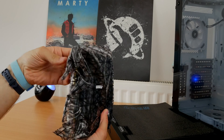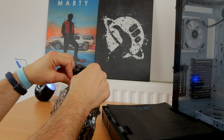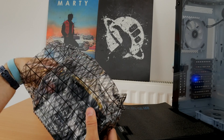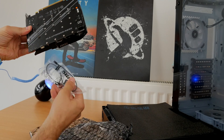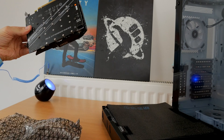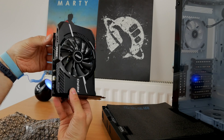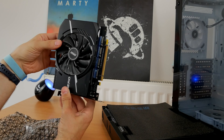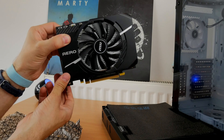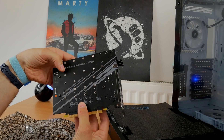This is one of the reasons I bought this motherboard. This is an M.2 PCIe adapter which allows you to install four extra NVMe drives on your machine. That means you can have a total of seven M.2 drives, which is pretty nuts. It does come with heatsink and cooling capabilities and is powered by a six-pin PSU cable, so it's worth making sure you've got enough cables. And it's really easy to set up as well.